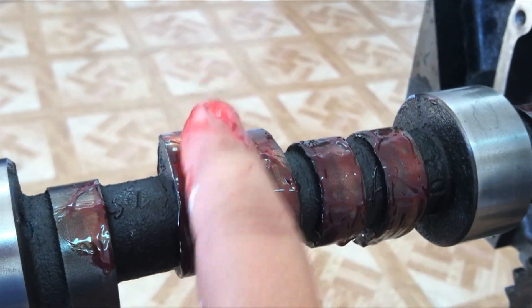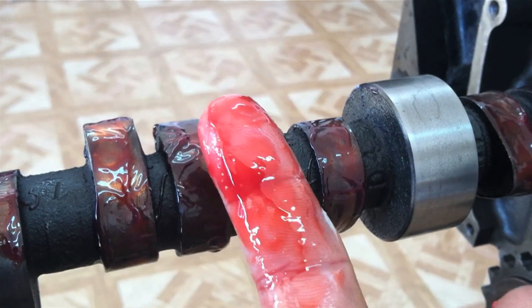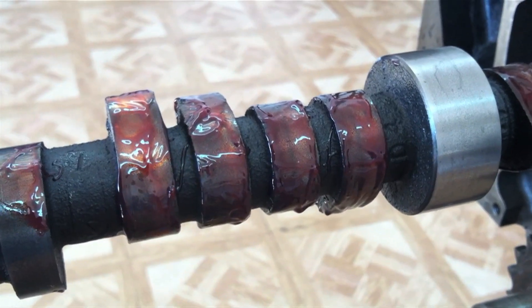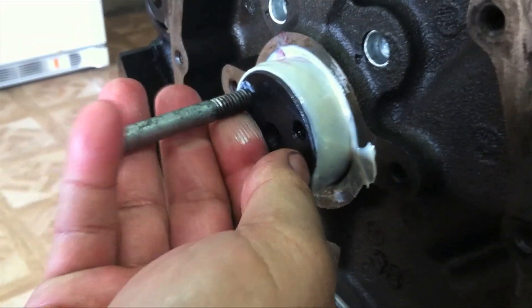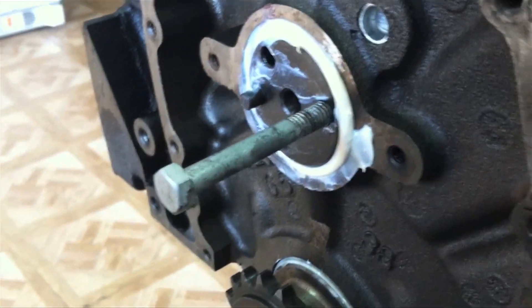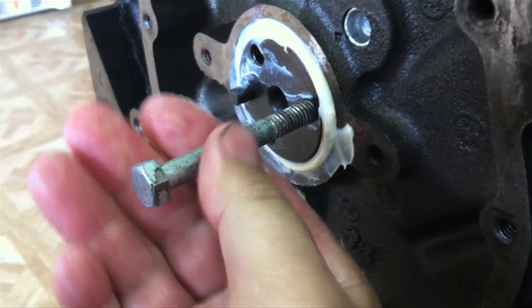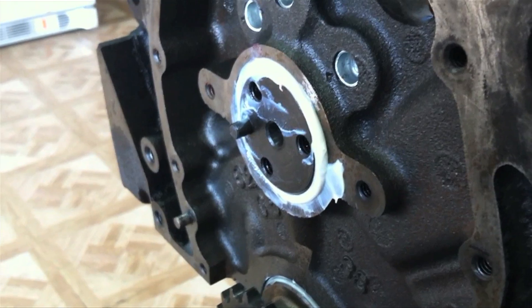When you're installing your camshaft, make sure you've got your cam lobes covered well with your high-pressure cam lube. These edges on the camshaft are very sharp, so be careful when you're installing these and when you're smearing the lube on them. Never force your camshaft in - you may need to spin it a little as you're pushing it in to clear some of the cam lobes, especially on a 383 stroker. Once you have it set, you can take your handle off, unscrew your long bolt, and we'll show you how to line it up.